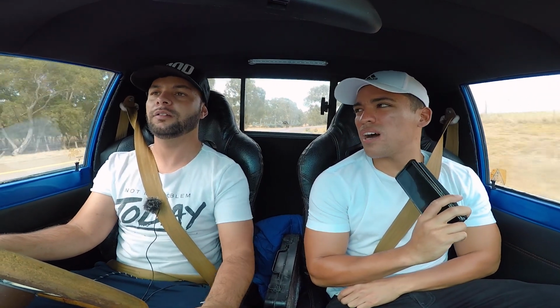Rafique, so tell me, what's been all done to the engine? Nothing's been done to the engine. It's a standard dual beams engine. It's all just surrounding mods with throttles, TRD flywheel, TRD clutch, and then obviously suspension of the bakkie. Further than that, nothing has been done to the engine. What's your best quarter mile time of this car? When I still had the 1400 suspension in, and 1400 diff, on rundown semis, did 13.4.